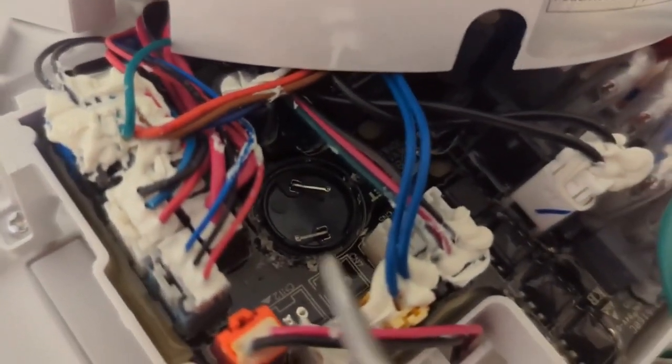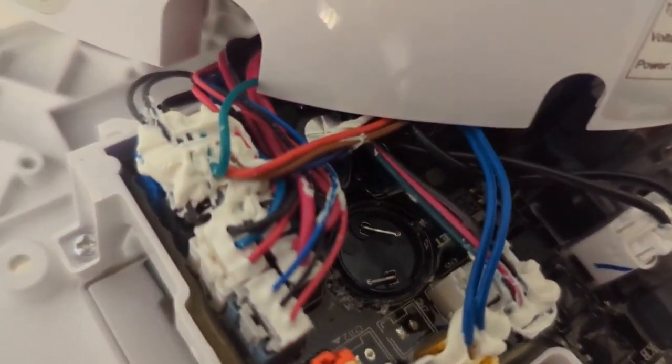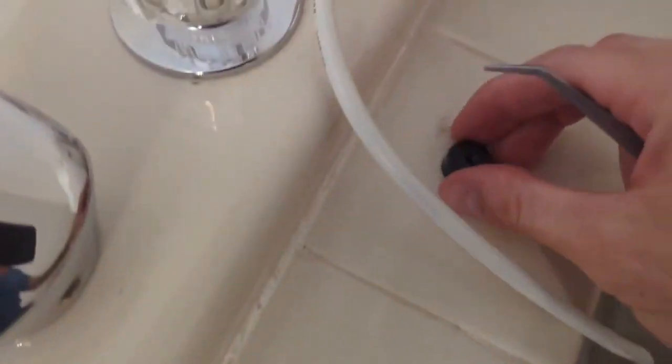Okay, finally got the thing — that was a pain. I had to scrape a little bit of that silicone out on the edge to get it loose. My strategy: I couldn't get it on the edge, so I just stuck the tweezers inside and kind of pulled sideways and yanked up. Once I got that, the thing came out. So here's your chirper, and that's the thing inside right there — this little thing that buzzes when it chirps. You just got to get that little film out, put the cap back on, and it won't buzz. The easiest way is to poke it from the other side, so I jam my tweezers in and you can see it's kind of coming up, so I'm going to pull that out now.